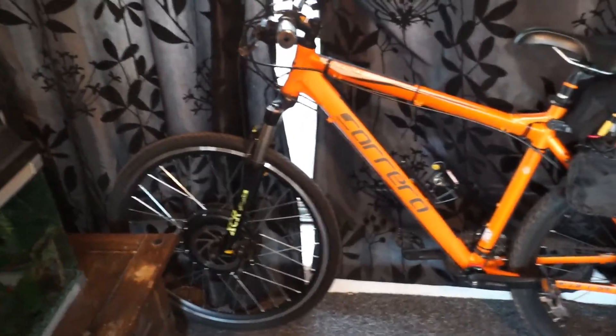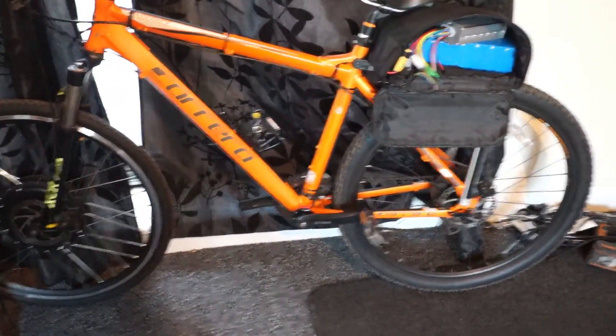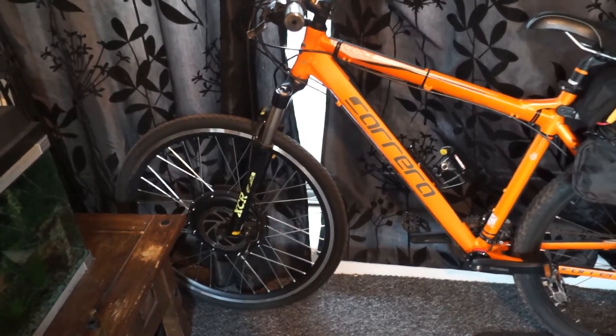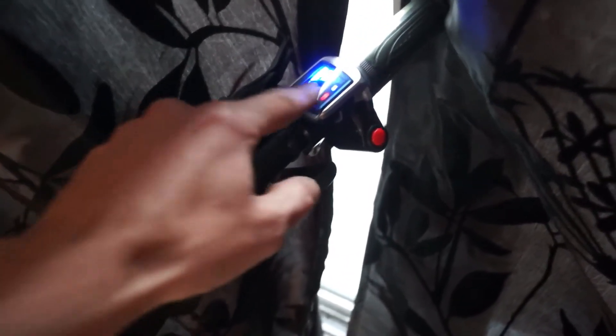It's been out and tested — it's a bit of a ball ache to build and you've got to do a few adjustments, at least on this bike. Finishing off: the crank sensor thing does work — it goes like a bloody rocket. I've just been clocked at nearly 40 miles an hour coming down my street, which is absolutely mental. I do need to fit a fatter tire on the front because it tends to wheel spin. The segment on the handlebars is correct — that bottom one turns red for empty, and it doesn't light up until you accelerate. If you give it too much it will go into the red.